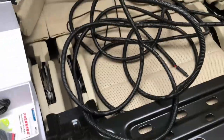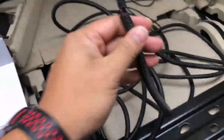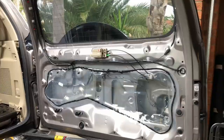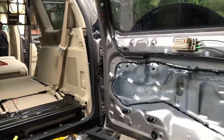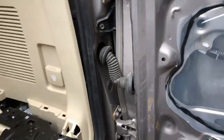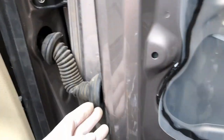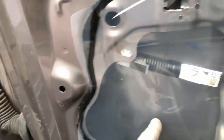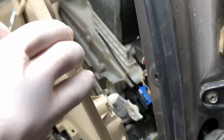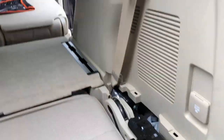It comes with a 10-metre cable that connects the rear camera to the unit. I've decided to put it inside some split tubing before installing it in the car. On the Prado the door opens outwards, so I decided to run that cable on the driver's side, just near the doors, and out through the factory grommet, and underneath everything, to give it a really neat installation.